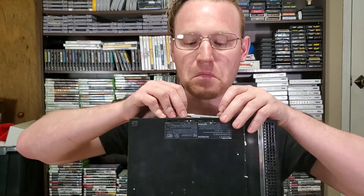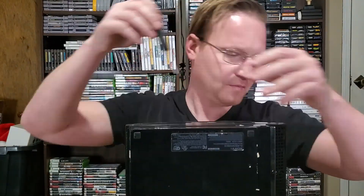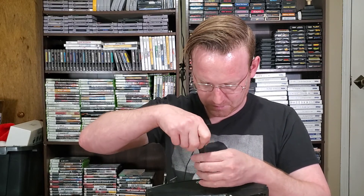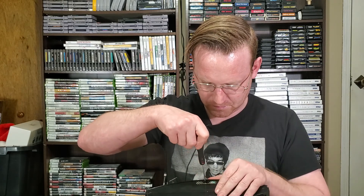With everything snapped back into place, we're going to reinstall the hard drive, put the blue screw back in, its cover plate, and then the security screw goes back into place. Well, there you have it — a breakdown and thermal paste replacement on a PlayStation 3 Model 1. If you have any questions or comments, put them down in the comment section below. Thanks for watching RetroWolf88 — make sure to like, clip, and subscribe.